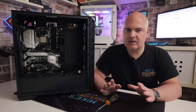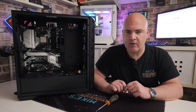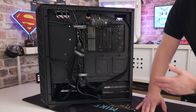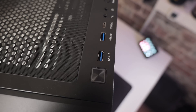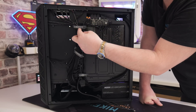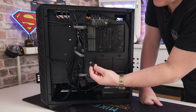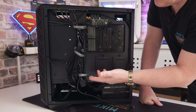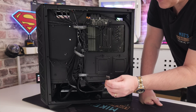If any of this is a little bit confusing to you, please feel free to let us know in the comments section or get in touch with us directly on our Discord and I'll try and point you in the right direction if you let me know what motherboard you've got. Now, to find out if you can actually use this card — if you've got the ports on your PC at the top — there are two USB Type-A's and a Type-C cable there. All you're going to want to do is find your USB Type-C cable or header, just follow the wire down through your PC wiring. I've already pulled this out and we can see the USB Type-C front panel connector here.